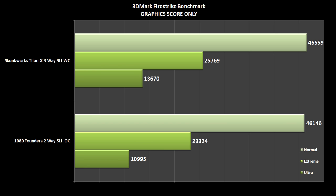There was a while where this system was actually in the top 25 in the world for the Firestrike 1080 score amongst any configuration — four-way, three-way, two-way, doesn't matter. So it was in the top 25 for a while, and that's what's fun to me. But the amount of heat this system puts out into the room, the amount of power draw it takes from the wall — even with the power reduction of Maxwell over Kepler — the three Titan Xs, when I start benchmarking, even in this newer house will dim the lighting. That's how much power it draws from the wall. So I really want to get that under control, and that's why I'm thinking two 1080s is probably going to be a better solution for me.